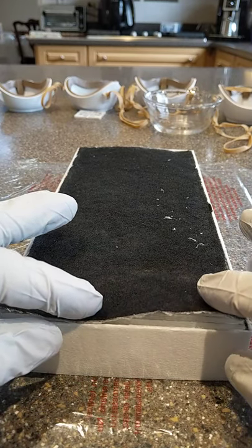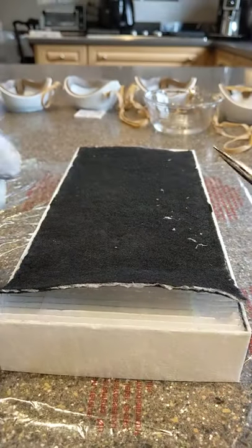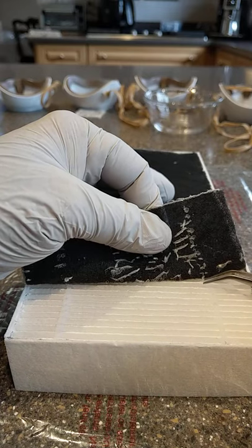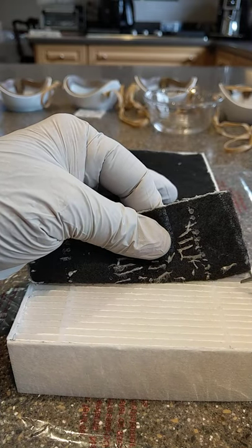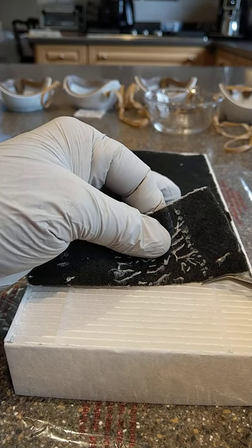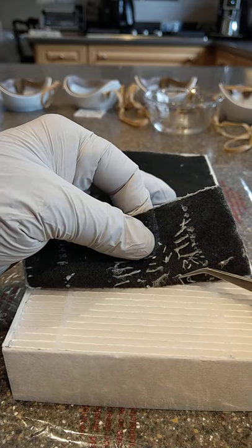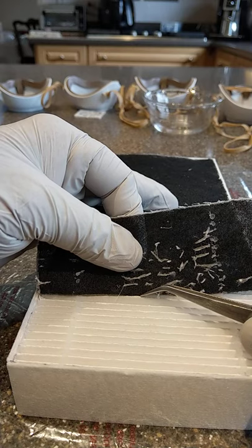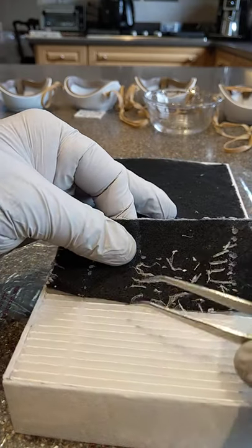In order to get this material, I carefully trimmed the charcoal media all the way around using scissors, then used a pair of tweezers and some careful management to disengage the charcoal filter. It looks like it's attached with hot glue — there are some areas where glue has been attached to the very front ridge of this filter media, and it does pull apart pretty easily. I would be disassembling this entire thing, removing the entire charcoal filter pad. But if you're just resupplying your own needs, you could simply free up a few rows of filter media by separating it like this, pulling it free on the side — sometimes a little glue blob will be on the side rails.